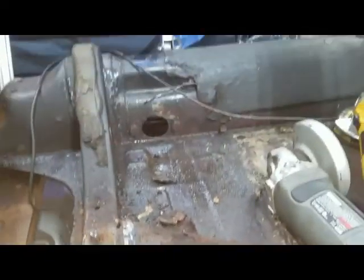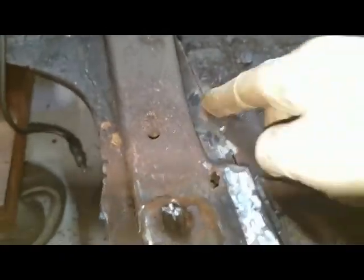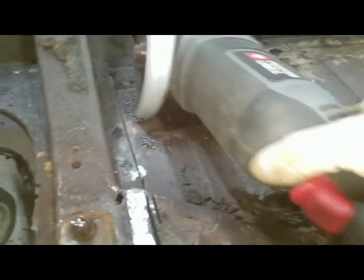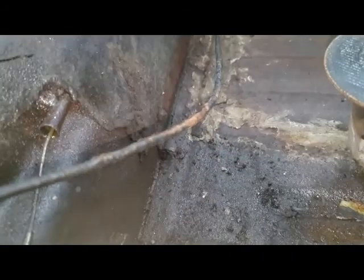We'll keep looking at it and keep banging away at it. My goal is to replace the floor pan, but I've got to get this front support out first. I still want to evaluate saving it, so I'm going to cut along here and start getting it out. Checking back in — I'm getting this floor pan off. Instead of fighting with all the press welds and spot welds, I'm just going to cut just inside the lip. I'm still thinking about whether to save the front support, but I'm taking this off carefully and cutting it out. The lip is probably about an inch wide, so I'll cut a little more than an inch to get this out.